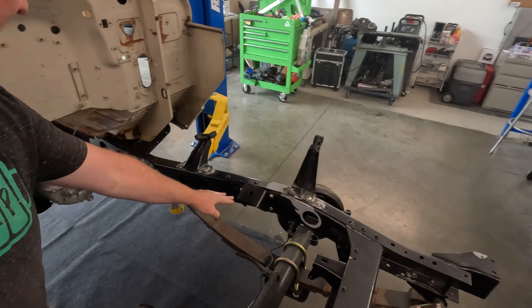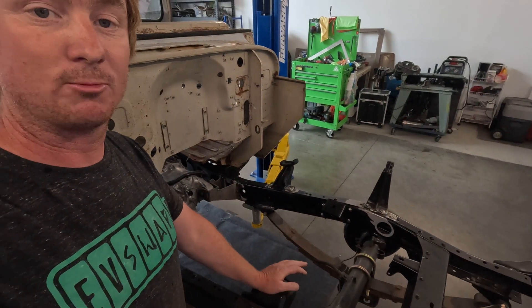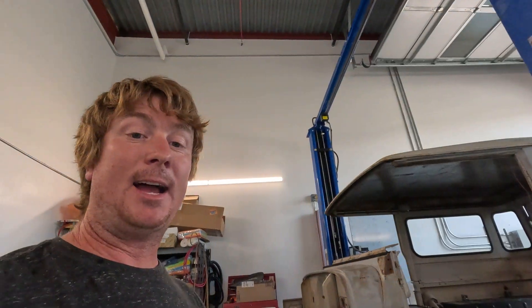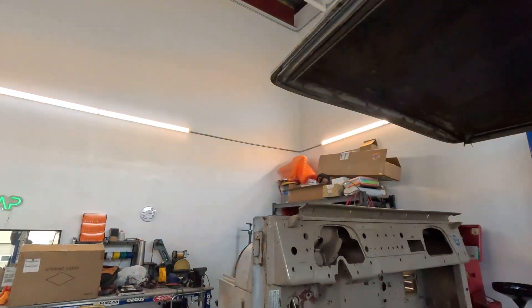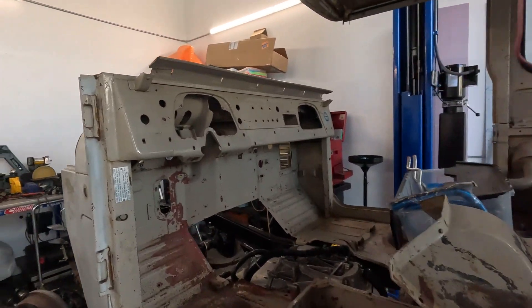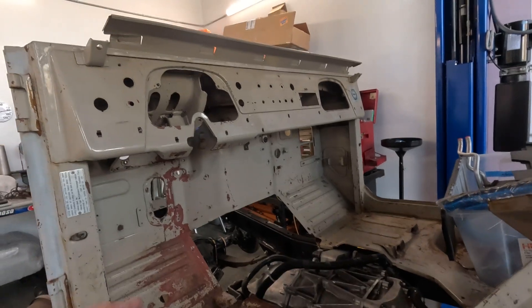I've got the motor mounts here. I'm going to mount the battery box to these original motor mounts so that the battery box will be able to fit into any FJ40 going forward. Then we're going to have to do the interior on this truck. These trucks are pretty bare bones — the whole body is basically painted the same color as the exterior. So I'm going to repaint the whole truck and do the dashboard. We're going to add a heater and air conditioning to this build, which my other builds haven't had. This build is also going to have some custom bucket seats instead of a bench seat like stock. So it's going to have a couple of little upgrades inside, but we're going to keep the feel and character of the classic FJ40 as much as possible.